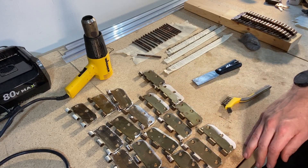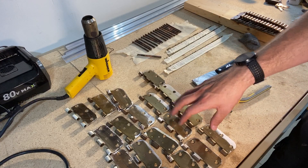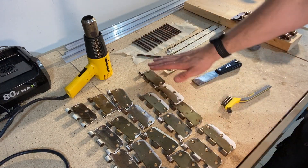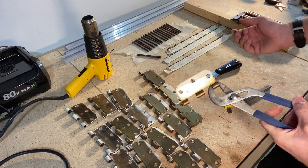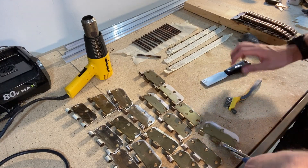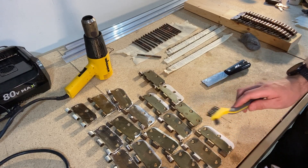I'll run through the setup for cleaning these hinges and getting them ready to paint. I already have all of my two-knuckle hinges done, and I've been doing four at a time. Now I'm going into the three-knuckle hinges. I'll first heat them up with the heat gun, then grab them with channel locks so I don't get burned, use my stiff scraper to scrape off as much paint as possible and any debris, then use a wire brush to get the surface as clean as possible.